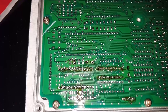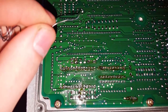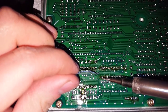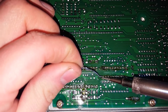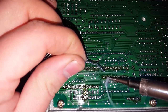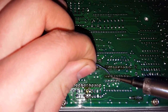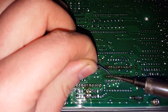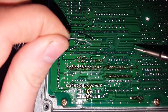Desoldering takes quite a while but soldering doesn't take nearly as long. I've already placed one of the components and soldered two posts to hold it in place. Now all you have to do is touch your soldering iron to the joint, touch the solder to it, and solder each pin. I'm going to run a time-lapse while I solder the rest of this together.